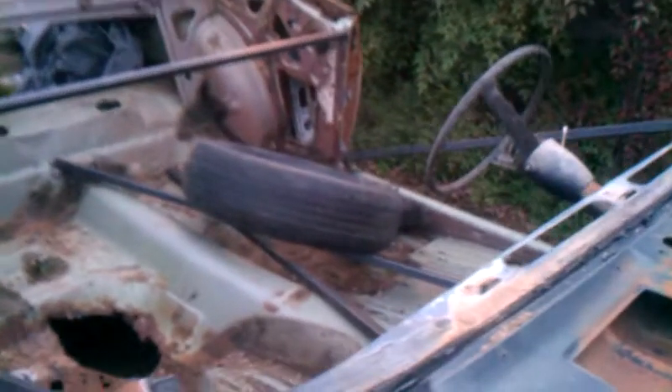I'm going to move the seating area about 10 inches back, roughly where that tire is. In the front, basically you're going to get rid of all this and put the Mustang II front end underneath it, move the front suspension forward — thinking a good three to four inches — basically where the tire will just clear the edge of the bumper.